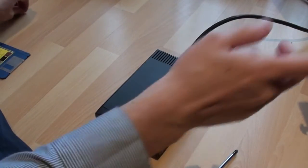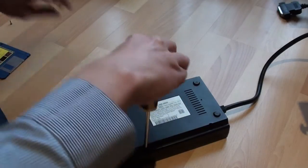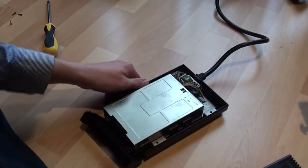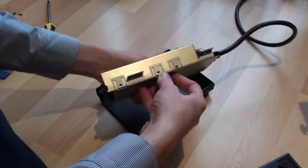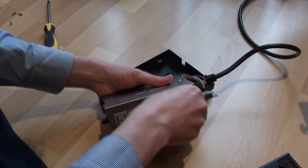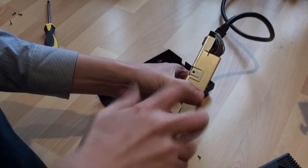I've removed the CDTV drive and disconnected it from the CDTV itself — it was kind of just hanging on by a couple of screws anyway. Strangely, when the casing is tighter the drive seems to function even less reliably than when it's loose, which is a little bit strange. I've tried running it with none of the screws present at all and it seems to work fine. It only seems to be when the screws are put in and it tightens up — I've even tried flexing the case a bit at the top in case something was sticking in the drive mechanism.